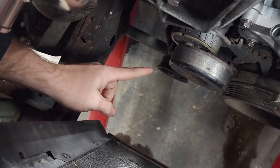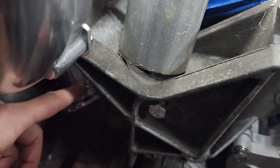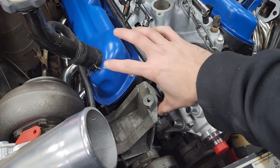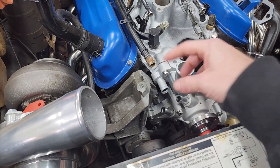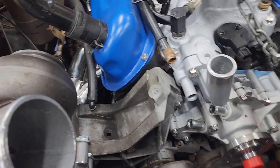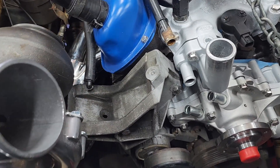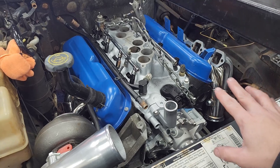Here's that idler pulley right there, so the pipe could come up anywhere in this area and then straight up to the V-band right there. With an alternator relocation kit, it should put the alternator somewhere around here — that'll give space for it and eliminate the auto tensioner. It'll be a manual tensioner with a reverse-thread rod somewhere. That's the next piece I need to fit up to make this hodgepodge of parts work — that and the header, which should be any standard header.